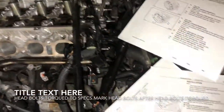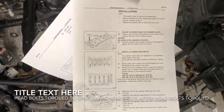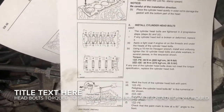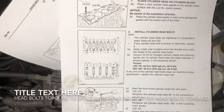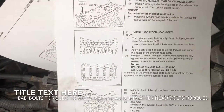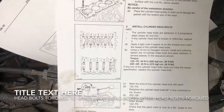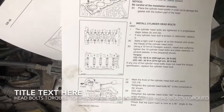I've already installed the head and torqued the head bolts per the recommended procedure. What I'm looking at here are the installation procedures from Toyota. In the middle figure you'll see the numerical order for how to tighten the bolts. On the right side it lists the torque specs for the 2ZZ-GE engine: 26 foot-pounds of torque in the US, or 35 Newton-meters in other countries.